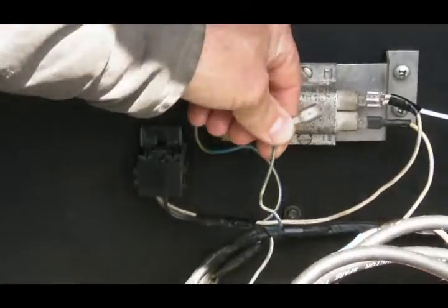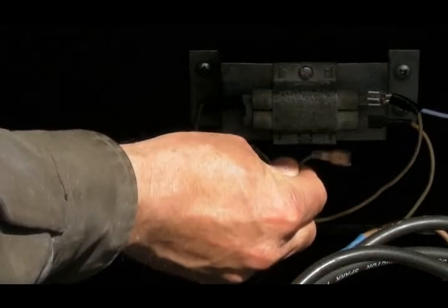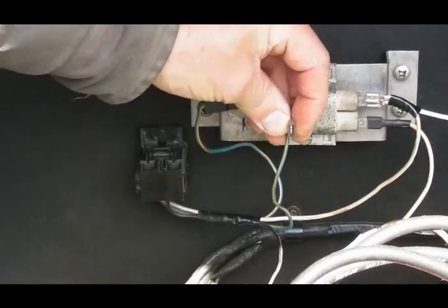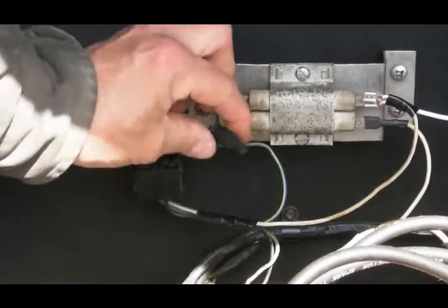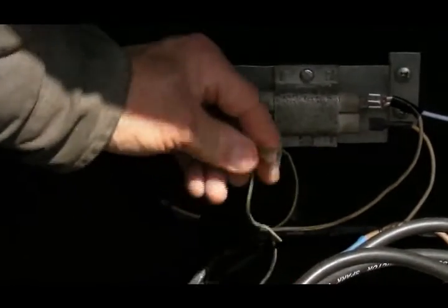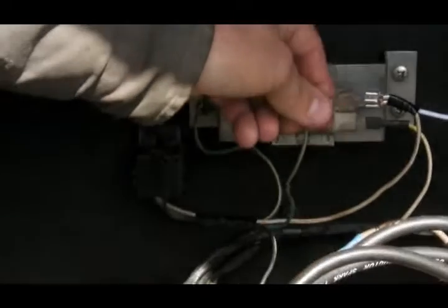The other blue-with-yellow wire is what triggers this relay — this goes down and is connected to the solenoid on the starter motor. The way you keep from mixing the two blue-with-yellows up: one blue-with-yellow has a male quick connect, so there's no way you could connect it to the wrong terminal — it would be male to male. And this other blue-with-yellow has a female quick connect, so you couldn't accidentally connect them together — it would be female to female. The female goes on the relay socket; the male goes to the inline harness connector.